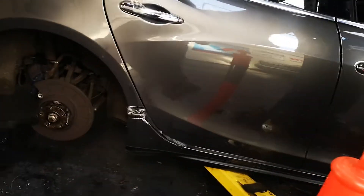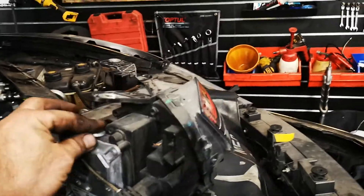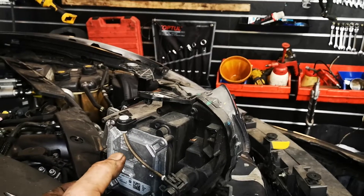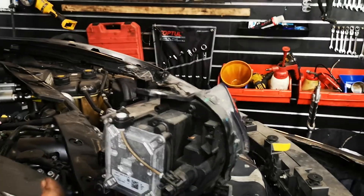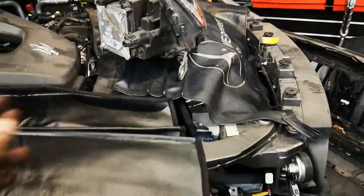There's a cable transfer for adjustment because of the design of the car, so this screw will have to come out to get the ballast out. There's the washer — that belongs under there. Take the ballast out and inside will be a D3S or D1S bulb — I'm not sure which. Turn it left to take it out and right to put it in. The plug is very fragile, so beware. I would do both headlights at once. Hopefully it's not a ballast issue — we'll know when we see the globe. Hope that helps with the 2015 Ghibli.